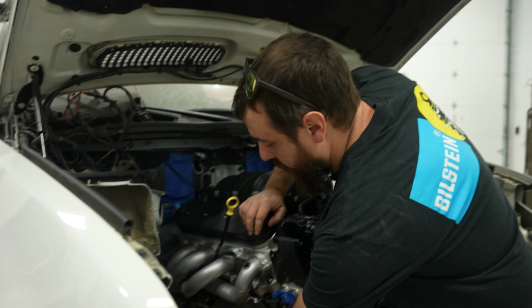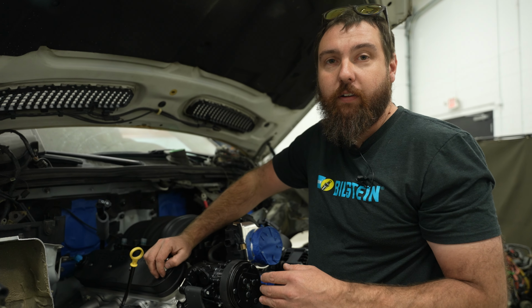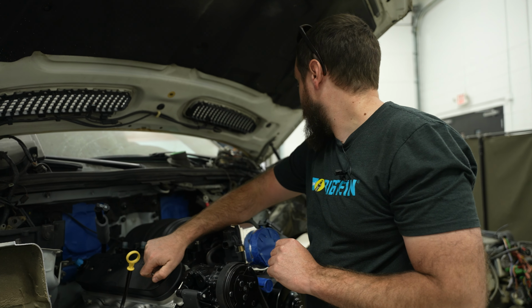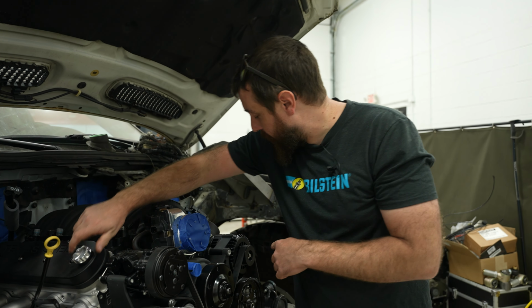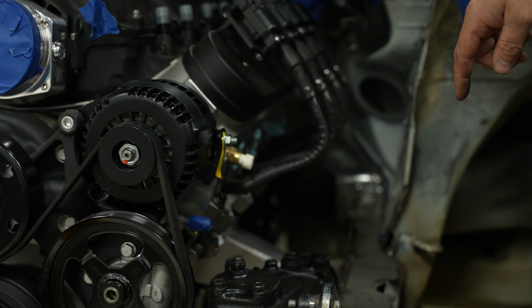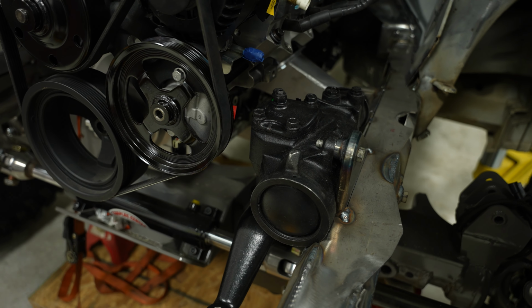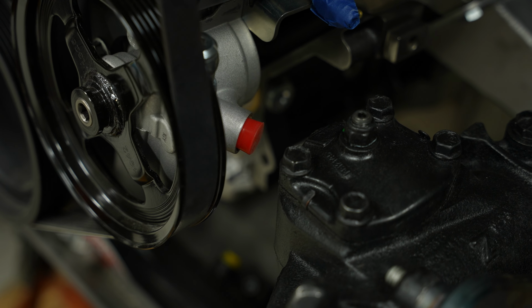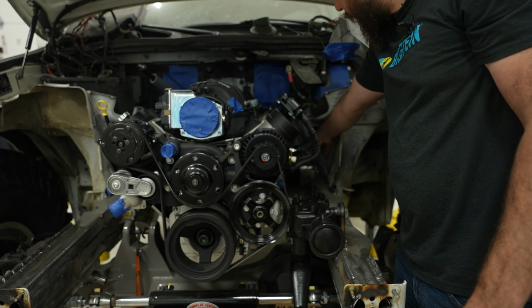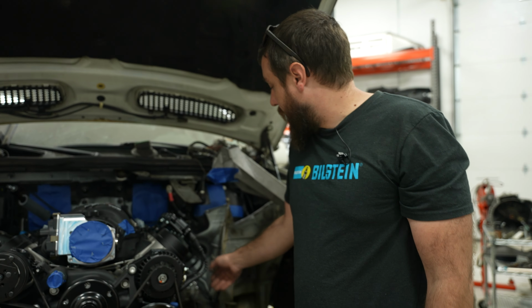But you gotta keep in mind there's an upper control arm that's gonna live right through here and a lower control arm over there. And it's gonna get real tight real fast. So we have to deal with the same issue on this side, but with a steering shaft and then a drive shaft. And then the differential is on this side of the axle. So everything wants to be in the same place. I'm just trying to make sure I mock it up with all the stuff in mind so I know things are clear. That's why I threw the steering box in. I know it's clear. It's very tight to where the fitting on the pump's gonna be. Then a steering U-joint's gonna be here, steering shaft back up to the column. So there's gonna be a big diagonal guy going across here. And then a header has to sneak down and around somehow.